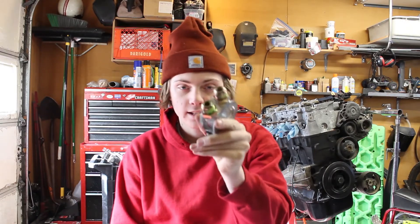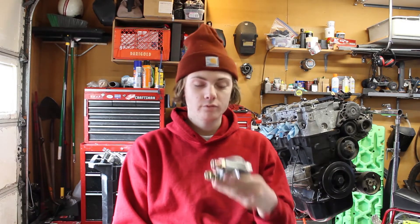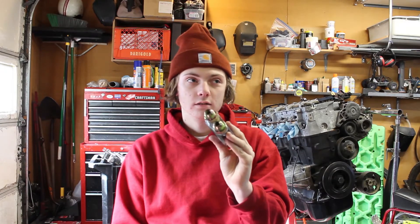They're about $200, which is too much for me for just an external oil cooler. So I went over to eBay and found myself a sandwich plate. This is meant to go between your factory oil filter in most cars, and it is thermostatted. It has 10AN input and output, and this will run to an external oil cooler, which I also got one on eBay for like $30. This one is thermostatted — at 80 degrees Celsius this will open. You can go without a thermostat, but for most engines it's just going to be a lot easier to tune when all your temps are consistent and your car warms up normally. So I went with the thermostatted one. It's a little bit more expensive but still only like $30, so not that bad.